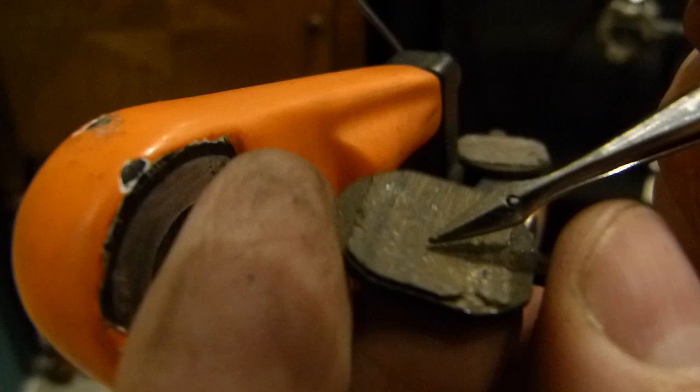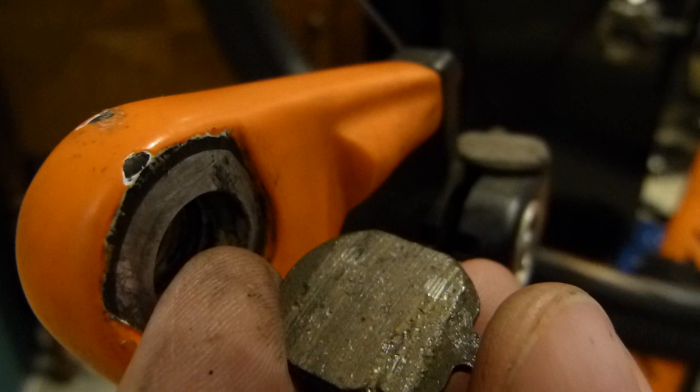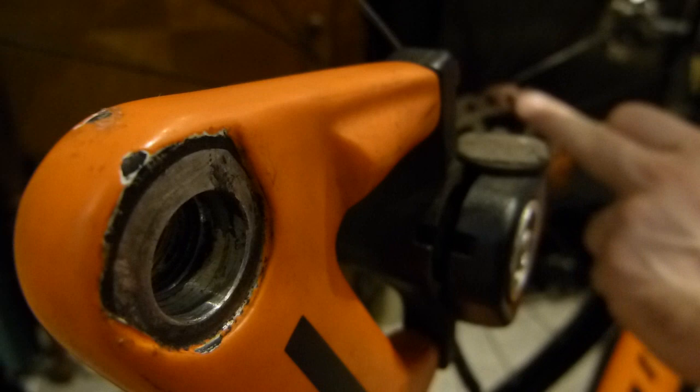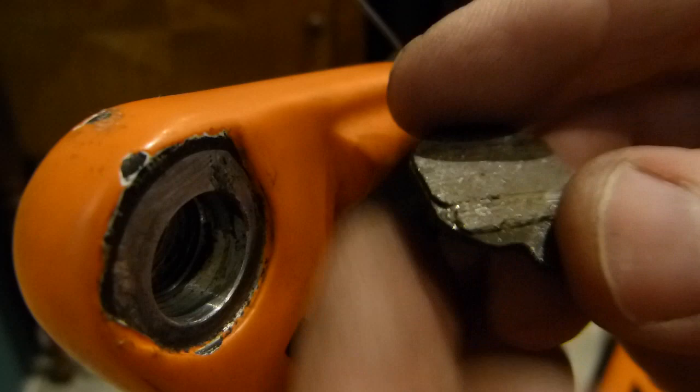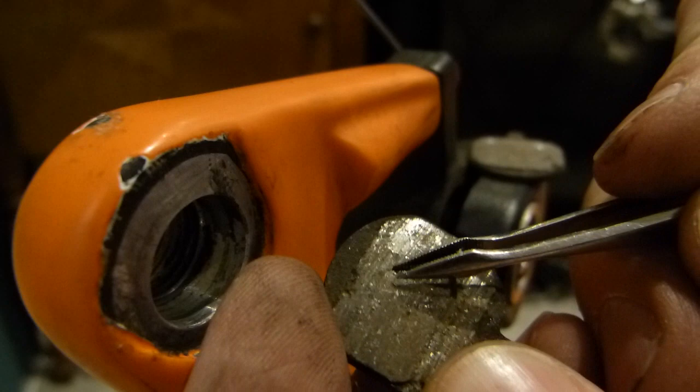wear the brake pads down below the wear mark to expose the rivets, because the rivets are made of soft metals. And now I had, for one hill or two or whatever, for a week, I had metal on metal contact. The metal rivet material on the pads contacted the metal rotor. I know it's out of focus, I'll get you close-ups on it. So this metal on metal contact should be avoided. There should only be brake pad material contacting the stainless steel brake discs, brake rotors.